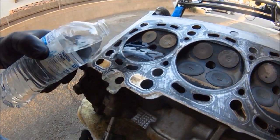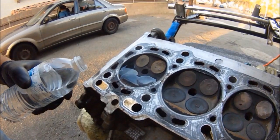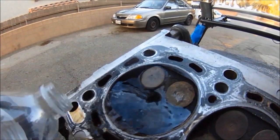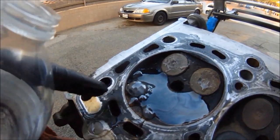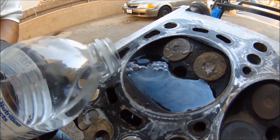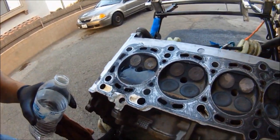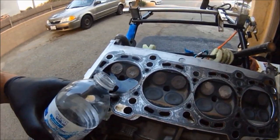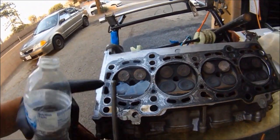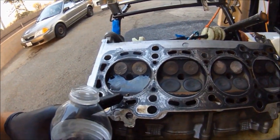See, we got that one submerged through water. We got this one here with the water behind it. I got the tip of this hitting the very back of the valve. Now we know we got bubbles leaking out this side right here. Now let's check this side — keep in mind we got it completely underwater. What I'm doing is going around the bottom side of the valve and I'm up on it. This valve is seating good — I don't see any bubbles out of there.